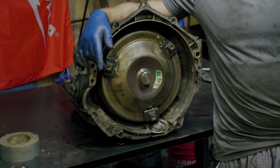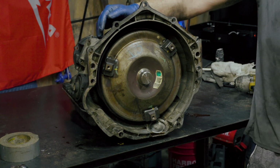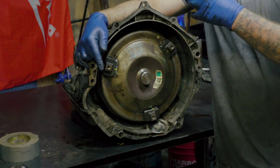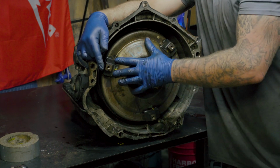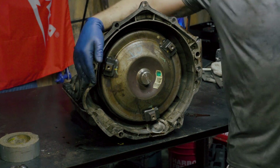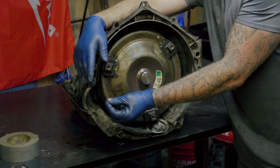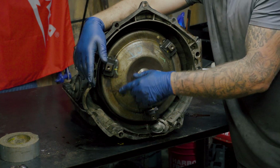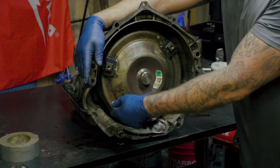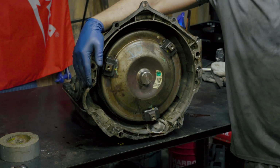So I pulled the engine. And when I pulled the engine out to do the head gaskets, which I videotaped all this, I got everything done. And when I got to the back to put it back together, I realized, and even once I had it out, I didn't notice anything. I couldn't figure out why. It was only catching the front of the teeth on the flex plate. And the reason it started getting worse and worse to the point where I could barely start the truck is because it had eaten the front of all those teeth off. So it almost had nothing to catch to.